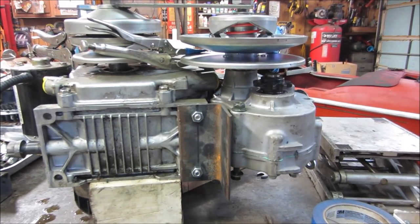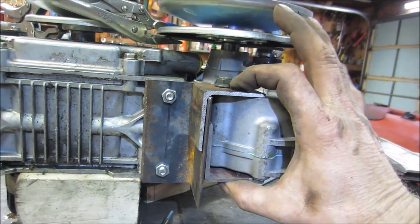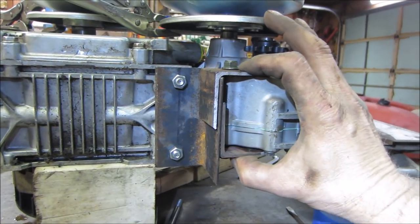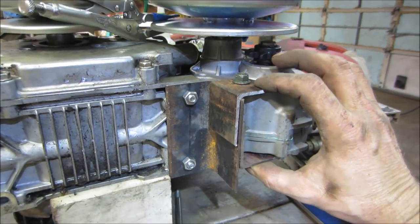I agree? Maybe? I'd say you bolt that together something like that. That should be just fine. So I'm going to take those pieces off, throw them in the sandblast cabinet, clean them up, and get a couple tacks on them. Tighten everything up, get some tacks on them, take it apart, weld them up solid.